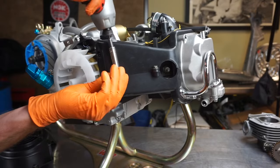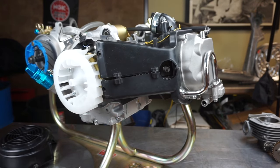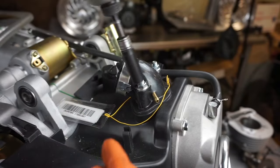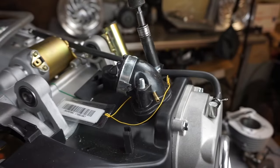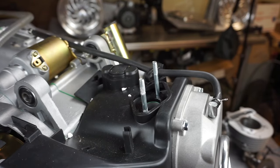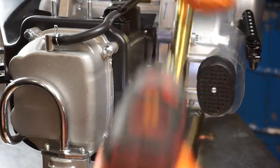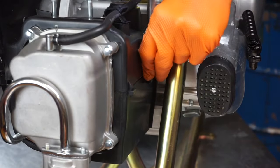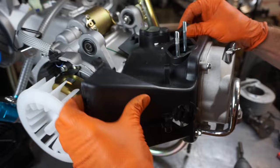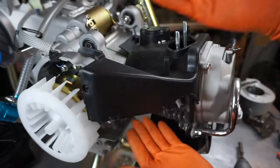Then we get the other shroud bolts off. At the top you've got the intake boot — move that; it's 10mm. There'll be some studs that stay in. You can also do the big bore head with this kit if you want, but I'm not doing that in this one. On the kickstart side you've got an 8mm here and one on top too. Your shrouds may be a little different. Pull that little hose out of the way and swivel this down — the cases open up like this.